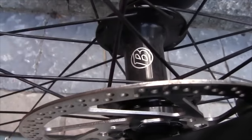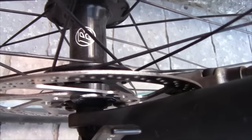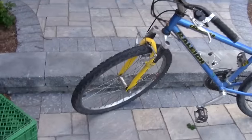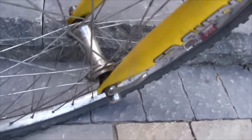If you've got a bike with a disc brake on the front, then you don't have to do anything to the brakes because that brake will just pull right out of there. The cross section of the rotor is pretty much constant so it will just pull straight out. However, once you've got it off, it's very important to make sure that you don't press the disc brake lever, because what happens is the brake pads go in too far since there's nothing for them to press up against, and then it gets uncalibrated and it's a real challenge to get it back to the way it's supposed to be. So just be careful of that when you take your front wheel off. Now that we've covered how to disconnect the brakes on lots of different common styles, we'll move forward with disconnecting the wheel itself.